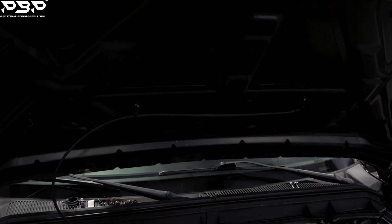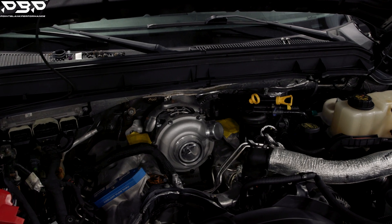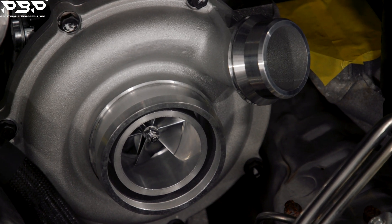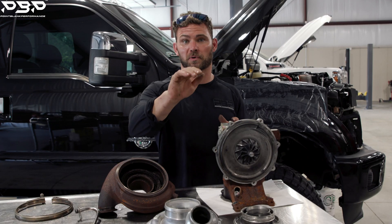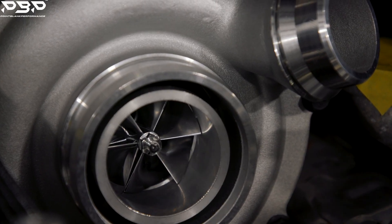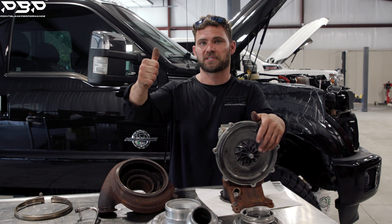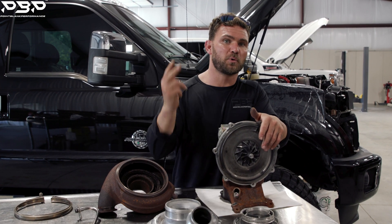But I just told you guys, I've got a surprise underneath the hood that's supposed to deliver a lot of benefits out of the 2015-plus Power Strokes. You guys are getting the first look at the brand-new drop-in BGT turbocharger. It's a 6366. We got the opportunity to test this turbocharger — it's not released to the public. The turbocharger was given to us, but we're giving it back because we're upgrading it to our F4/F5 HP package. We've got a factory BGT drop-in that's supposed to fix the high drive pressure, deliver more boost pressure, and overall be a more efficient turbocharger.